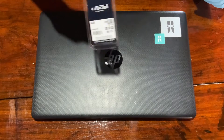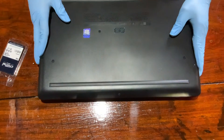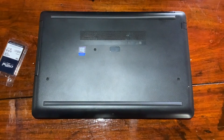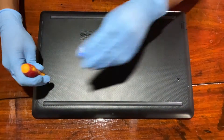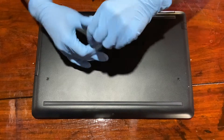Welcome to Riafatek series. Today we're going to upgrade the RAM of an HP 15 DA1018 TU laptop. The system comes with 4GB RAM and we are adding another 4GB. The system supports 2400 megahertz speed, but we're going to upgrade it with a 2666 megahertz Crucial 4GB RAM — that won't be an issue since the system supports it.